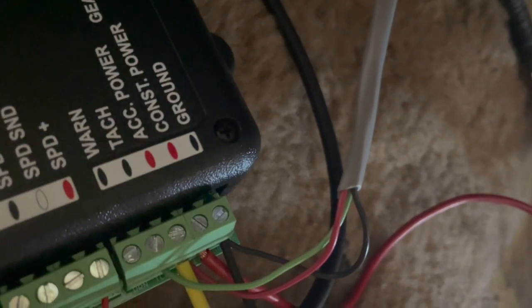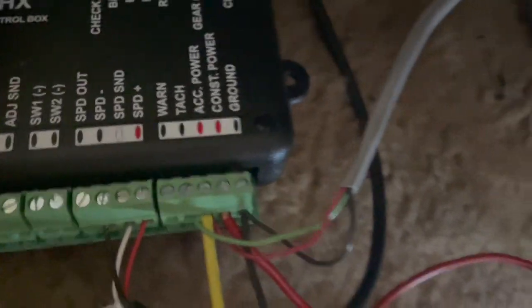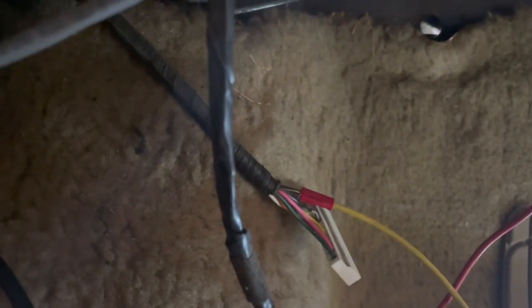All right. Well, I just got all of this hooked up. And we have a flashing light. I don't know if you can see it. Where'd it go? So it's doing something. I got my 12-volt switch out of the old cruise control pack. The brown and white wire is a 12-volt ignition. So that's not as neat of a connection as I wanted it to be, but it's tight. It'll work. I'll clean it up a little bit before we tuck it all in there.